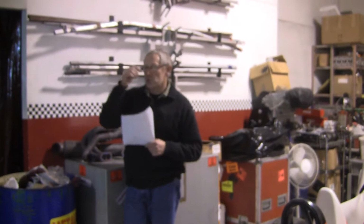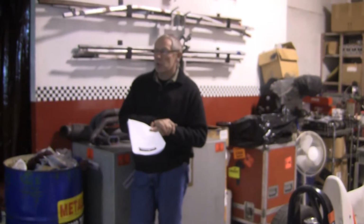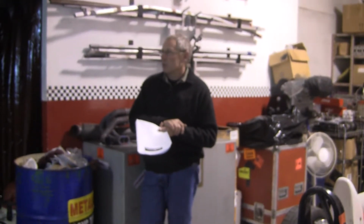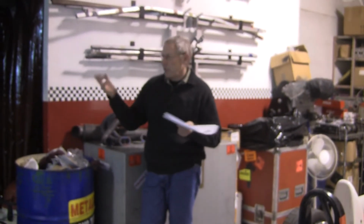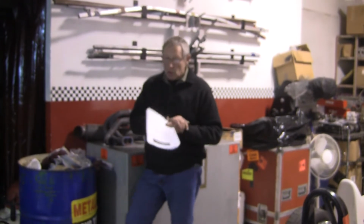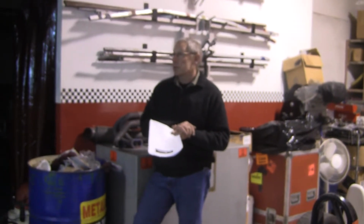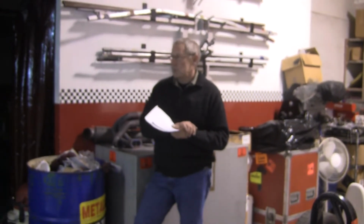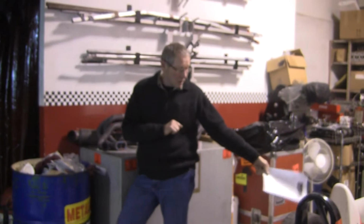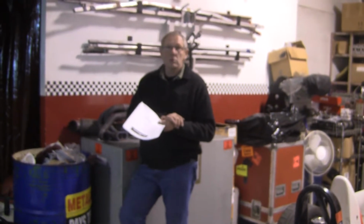I know the shocks we use on these early 5000s, the very early 2812 Koni, the twin tube Koni, they're just shockingly bad at not being a pair. I mean, 2 or 3 races and then one shock's dead and the other one's still working fine, and it just drives you insane. The new modern shocks, they're a lot more reliable. But all those old Armstrongs that are on a lot of the older cars, they're inherently unreliable as well. But we'll sort of pass that. An old shock these days is one of these Bilsteins, but very seldom do you ever have any trouble with a Bilstein. They just seem to go and go and go until you break the end off them.